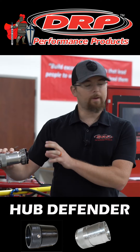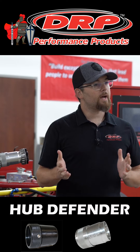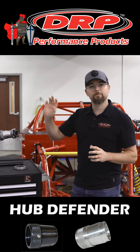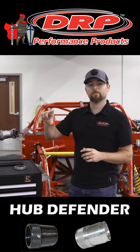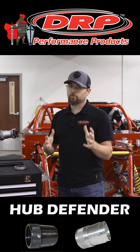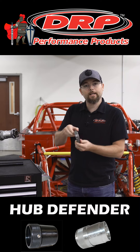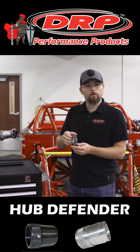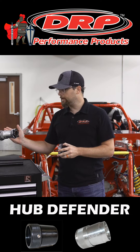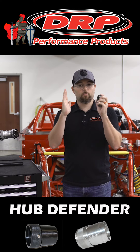Applying a spacer that goes in between the inner and outer bearings. Once you have the spacing properly set, we can tighten this thing down, spin the hub, and it's going to spin just as free as if you were to back the nut on and off. But here's the difference: when the car or trailer is set on the ground, there's no force cocking the bearing, causing it to run on the outer edge, because now we are able to keep the bearings parallel to one another. So the face of each bearing is going to run parallel.